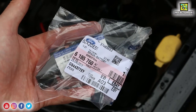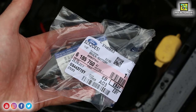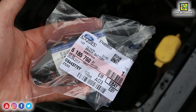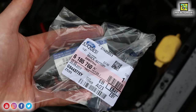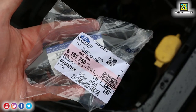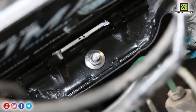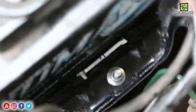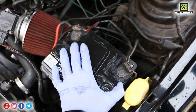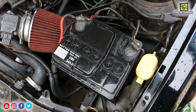I've ordered a brand new battery clamp for it as well. The M8 bolt I ordered won't go in the hole - I think the threads have gone with the rust - so I've got an M6 bolt and an M6 nut. I'm going to put the bolt in from the bottom and put the nut on the side. I'm going to reinstall the battery now - again, everything I've used in this video I'm going to put a link to in the description. There's a new battery clamp on with a new bolt and nut - the battery is fully secure, absolutely rock solid and in place. No more cable ties!